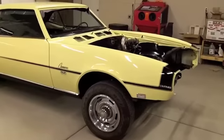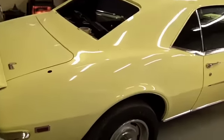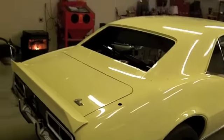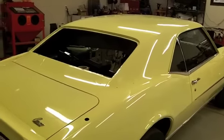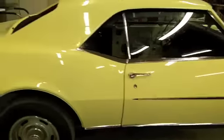I may have to wait until I can catch a nice sunny day when it warms up, maybe in the spring, to put the vinyl top on. I'll probably go ahead and throw the rear glass in first, because I'd like to have the back window in before I do the vinyl. When I put tops on, I center it on the car and then put tape from the top to the glass to kind of hold it and give me a reference point, then flip over half of it and come back to the other side. I bought a ribbon to put the back glass in and got it cleaned up and ready to go — I just need to get my wife to come out and help me set the glass in.